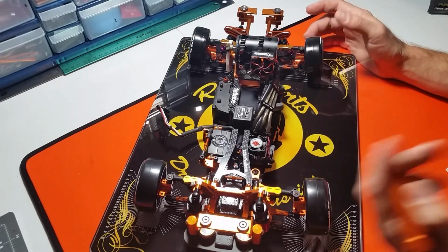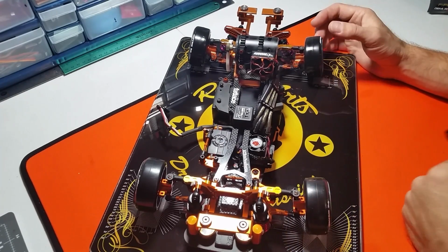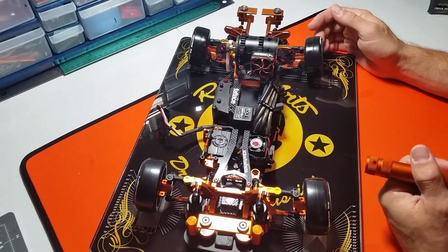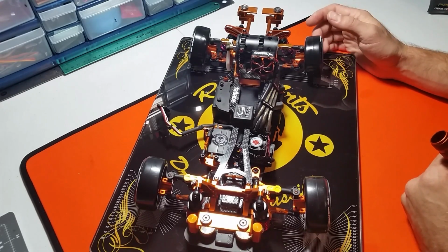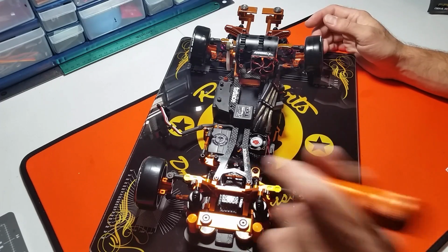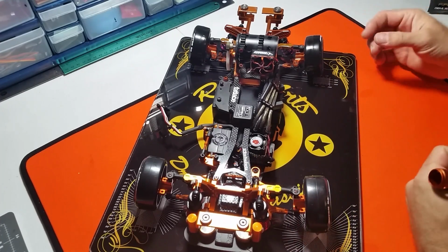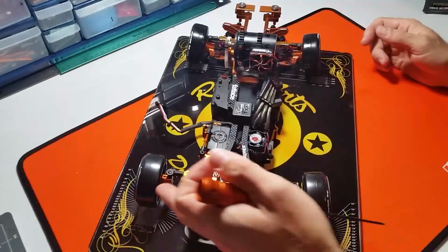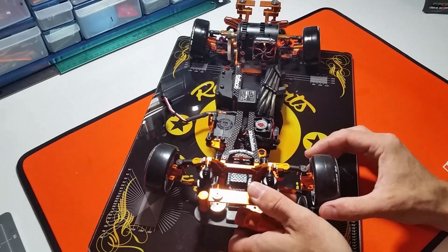The big things are the rear wheel drive kit, and changing out your upper arms, at least in the front, to some better, more stable arms that don't have any slop in them. You'll pick that up in your gyro, the speed wobble, if you don't get good. You need to tighten everything up. You don't want slop in your arms. You don't want slop right in this area. You know what I mean?